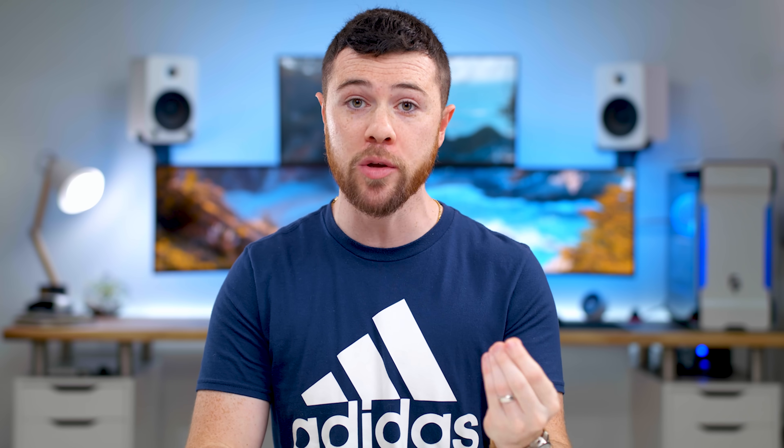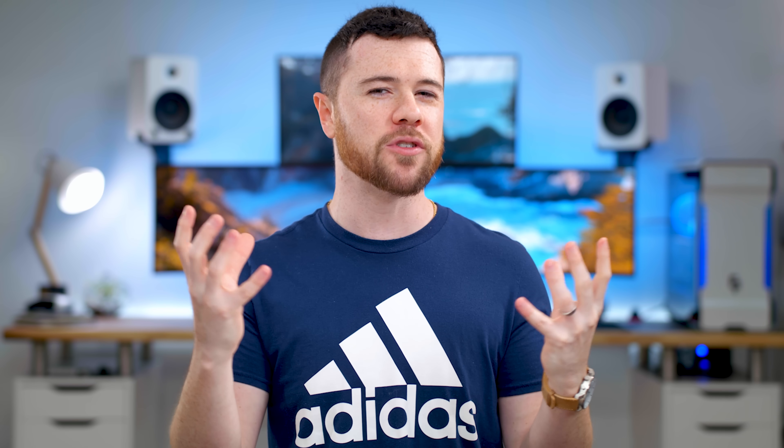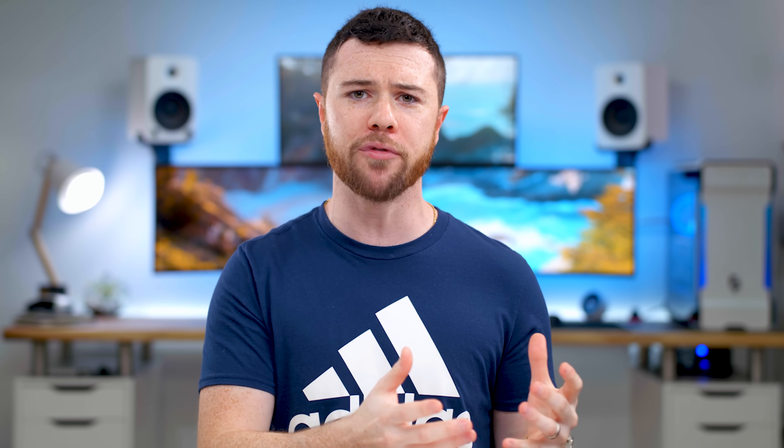Just completely night and day. This is the new one. This is the original. The sound profile of the new V2 version — with all the inserted silicone dampeners, rubber, and foam — sounds too dampened, in my opinion. It's more of a mushy feeling, which if you're gaming is fine because it's still nice and smooth — that same smooth linear switch. But the sound is just mushier and obviously dampened. The new version came in at minus 33 decibels with the original coming in at minus 10 decibels, so close to 20 decibels difference with the new one being that much quieter. So if you're gaming, streaming, or talking to your friends, the odds of them hearing this keyboard is significantly less because it's just that much more dampened now.